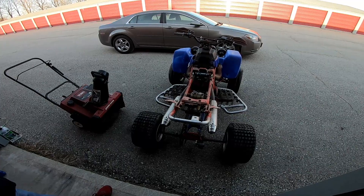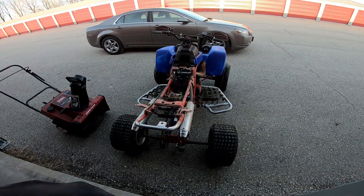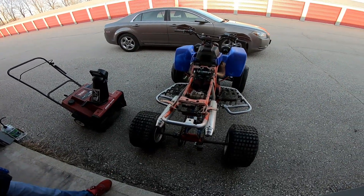We're at the storage unit. Super windy outside, guys — that's why I'm kind of staying inside for right now. We'll just try to start it up. We did a compression check again and it only had 70 pounds, so we don't know how accurate the gauge is. I'm going to get another gauge just to double check, and if it is truly 70, we might have to do a top end.